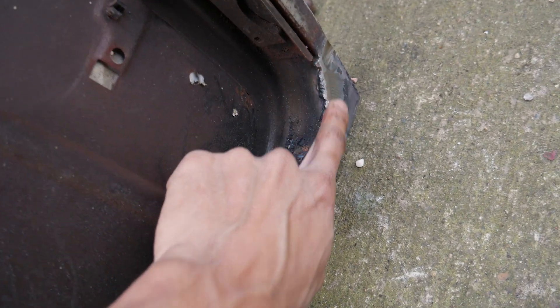This is the door I've just completed just now. So you can see here where I've cut it and welded it along here. I weld from the inside rather than the outside — some people prefer to weld on the outside. Full seam weld left to right for strength, I've done it.